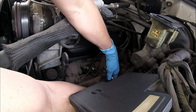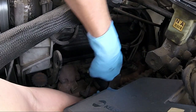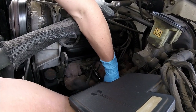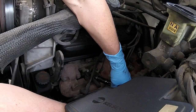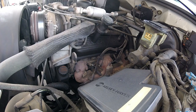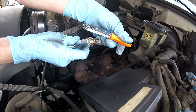We're going to remove these spark plugs — I'm only doing the front two on this side for the video. The spark plugs were in pretty tight, so whoever did this job last didn't torque them to factory specifications. A little bit of oomph and the spark plugs come right out. If you strip them, you can get a thread chaser. When you remove each plug, make sure you inspect them — look for moisture, either oil or fuel, and check your gap.